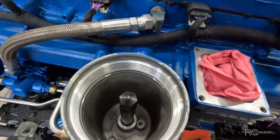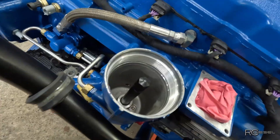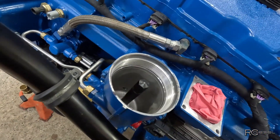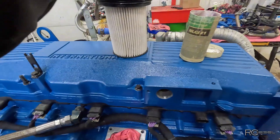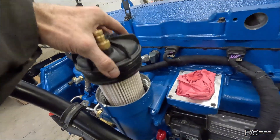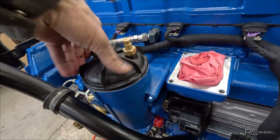I really don't want to have the fuel filter get forgotten — that'd be bad. I like to put a little bit of grease around the inside where that O-ring rides when you put your lid on. Make sure you put a new O-ring on before you put your filter cap back on. With it greased it should screw together pretty nice.